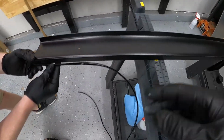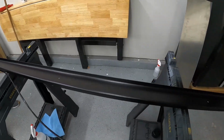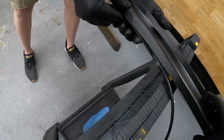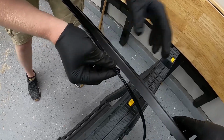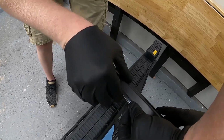So now it's been painted, I'm gonna put this trim back on here. We put the trim on to begin with just to offset the actual height so we could make the brackets to the proper length. This trim actually has an adhesive in the center of it, so once you push it on there far enough, the adhesive pops and it will help stay on there.